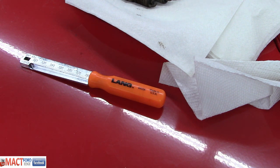These stupid things here fry the PCM or something. Well, they changed it. After 2008, they changed the PCM, so the coil drivers were separated and isolated better. So like my fiance's, hers wouldn't fry a PCM? Earlier years of hers, 2010. No, hers won't fry a PCM. But mine will? Yep. The coils overload the coil drivers on the PCM and burn them up. That is stupid. So you had that happen to this car? No, never had to have it.